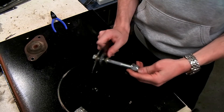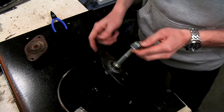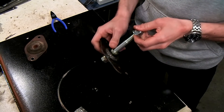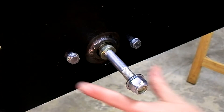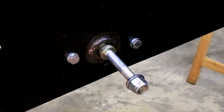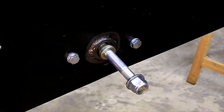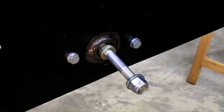This is what the final setup will look like. I'm going to remove the bearing and paint this plate so that it won't rust, but this is the basic construction. My new radius arm mount uses the original mounting holes and will sit in the exact same place, but instead of the rubber bush there's the spherical bearing. And instead of having it mounted from the front, it's mounted from the rear - as were the Series 2 radius arm mounts.